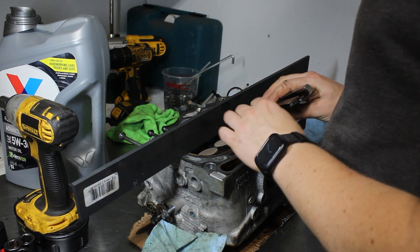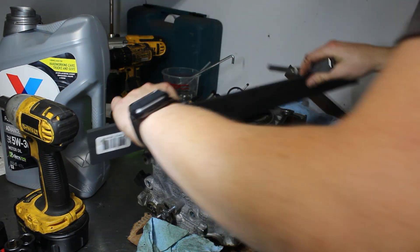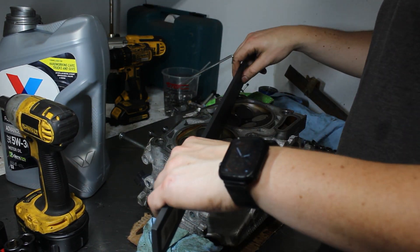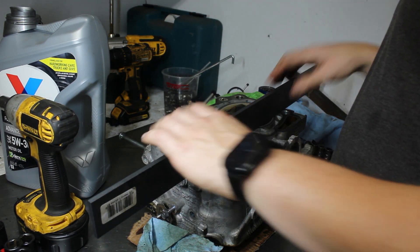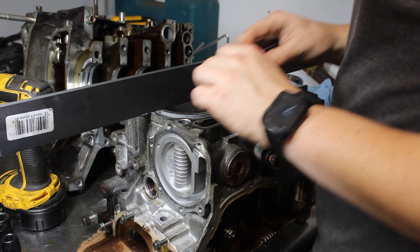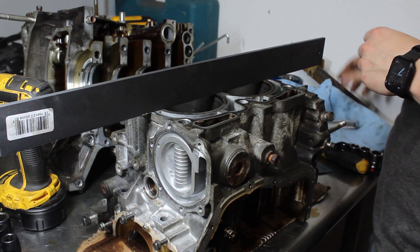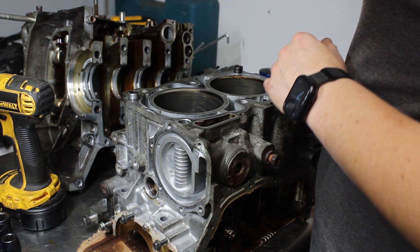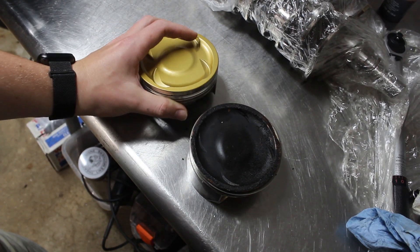So really, where I'm at here is the engine is overall in very good condition. Visually it didn't look great — it had a lot of dark varnished buildup, which is kind of weird because I was doing regular oil changes, so I'm not really sure what's going on there. But the only damage was that cracked ring land. The cylinder heads are definitely going to need a whole refresh. But as far as everything else, I'll replace those pistons, do new bearings, and it's not looking like it's going to be a huge overhaul. I will be bringing all these parts into the machine shop to get some things taken care of just to be safe. Also, I will be shooting for more power, because why wouldn't I? As always, thanks for watching, feel free to like and subscribe, and stay tuned for the next part where I start building the motor. Bye.